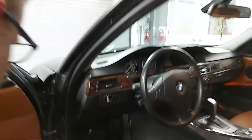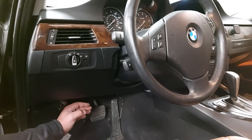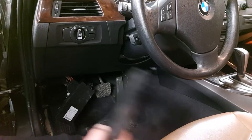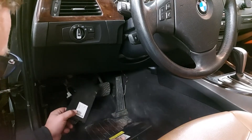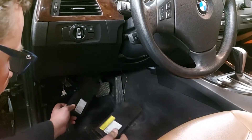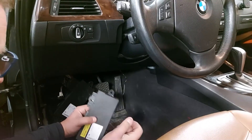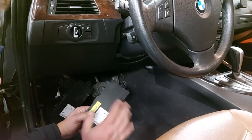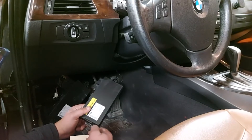It's on the driver's side — there's going to be a panel, and you take three screws down and the panel comes down. Ours is removed for ease of use, but it will sit here; the one in the car is actually up in there with a bolt. You take the bolt off, unplug this, unplug this, stick it in the box with the DME and the key, and send it to us.